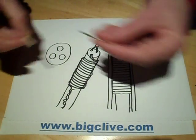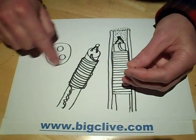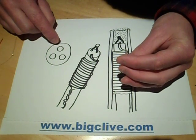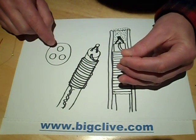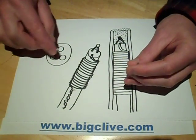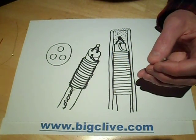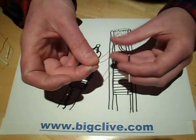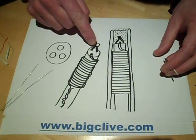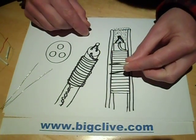The core with the heat element on it has a cross-sectional profile that, despite being a very small diameter — only about 2.5mm — has three distinct holes running right down the middle. Two of the holes are used for a thermocouple, and the other one is used to feed the wire for one end of the heating element.